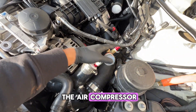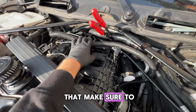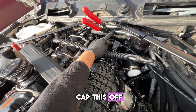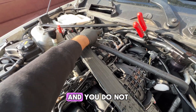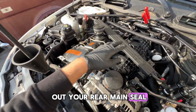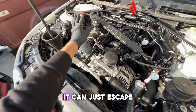Set your compressor to about 40 psi — you definitely do not want to pressurize this thing to 100 psi because something will pop. Before you start, make sure to cap off or clamp the hose coming out of this inlet using hose pliers. If you don't, you'll be pushing 30 psi into your catch can or directly into your crankcase, which can crack your valve cover gasket. Also remove or loosen your oil cap so that if pressure builds up in the valve cover, it can escape rather than popping your rear main seal or oil pan gaskets.